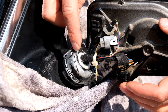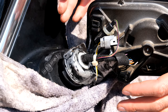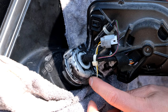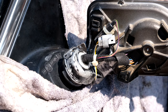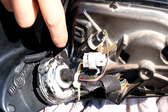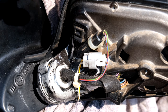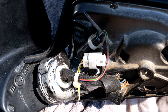If I put almost a clump of epoxy here it'll offer quite a lot of support because it'll be thicker, but I need to be aware that the cover still needs to go over this and close. There's also some space to build some up at the bottom. So I'm going to put the cover on and see how much space there is. Checking the clearance — there's still a lot of space here and that's where the crack line is, so I can build this up quite a lot with epoxy. I just need to check that the other cover will also fit over the higher surface of the epoxy.